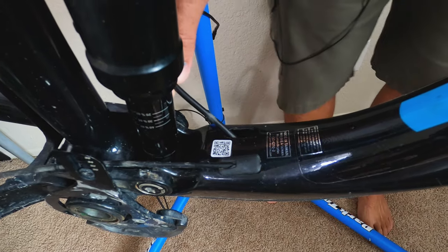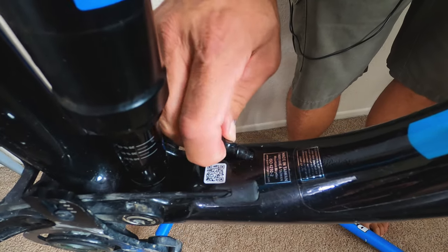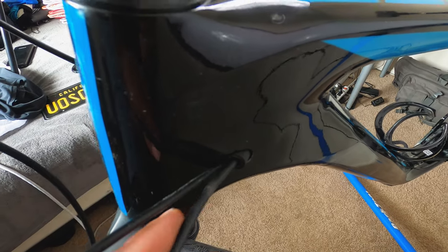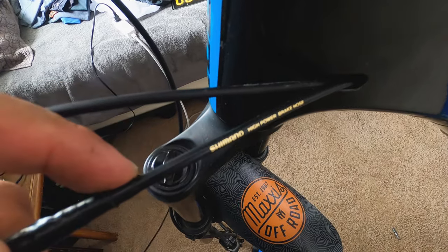So we're going to push the cable through this end and pull it out the other from the top. Just feed it through nice and easy and slow. Right here is the top part of my frame — you can see this is the cable for the derailleur, this is our brake line, we're going to pull this out. You can see the brake line actually has this little foam piece on there so it probably doesn't make so much noise rattling inside the frame. We're going to pull that nice and slow, pushing a little bit on the other end, and you can see our tape is starting to come out. And that is the gold lettering of our new brake line — so we're good.